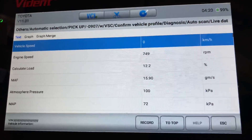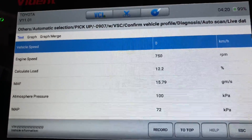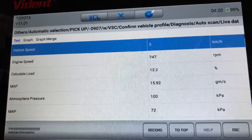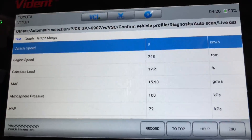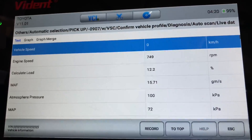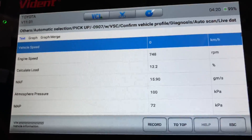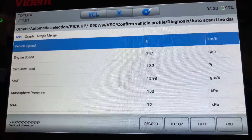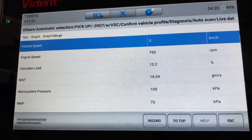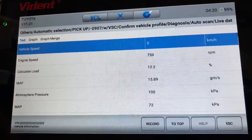Calculate load is what we're talking about. Just keep looking at the load — it's 12.2, which is low. That's because it's a manual. Normal load on a September 09 onwards Hilux or a 150 Prado 1KD FTV is about the 15 mark. They can be 16, 17, 18 — don't be concerned. If it goes beyond 18, then we need to look at the other readings, the kilometers, basing it on averages when to replace the injectors.